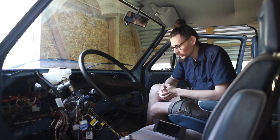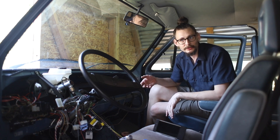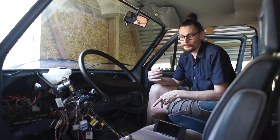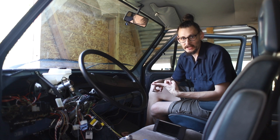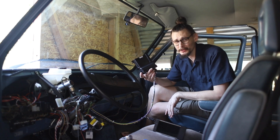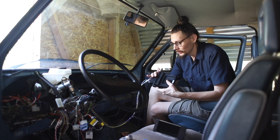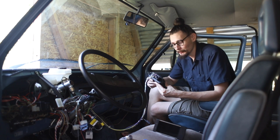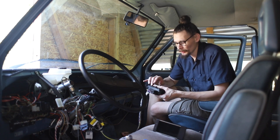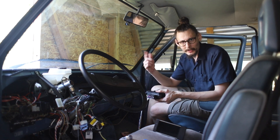If you've been following along, you might know that the last head unit that controls the drive unit failed to function properly — it just needed to be sent back to the manufacturer. They don't make it anymore, so we had to get their second generation product. This is the T2C. Very similar, but it doesn't have a screen — you have to use an iPad app to change settings. Because it's the same manufacturer, it basically bolts right in with new wires and new plugs. The only difference is it required a couple more fuses, but we had extra spots in our fuse board, so we wired it up and set it in.